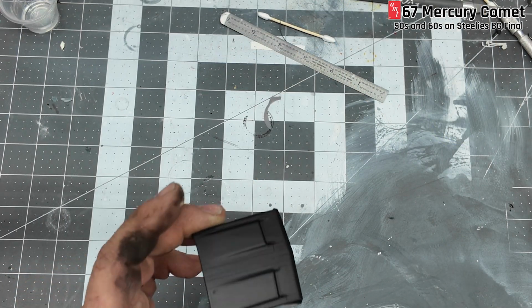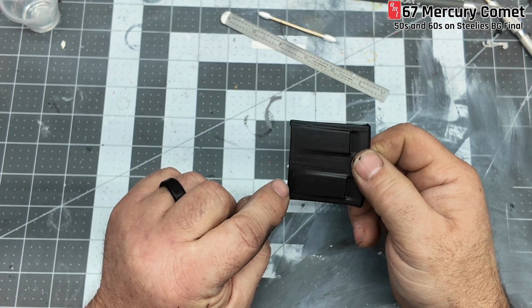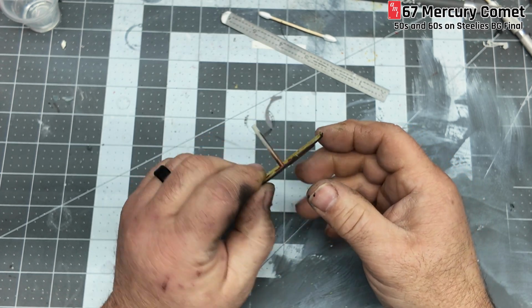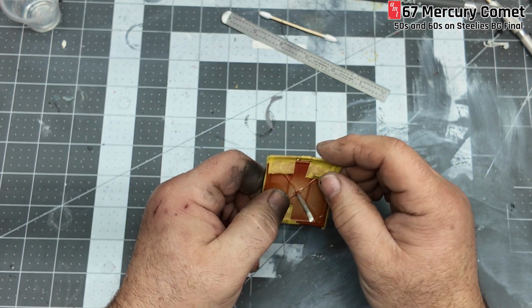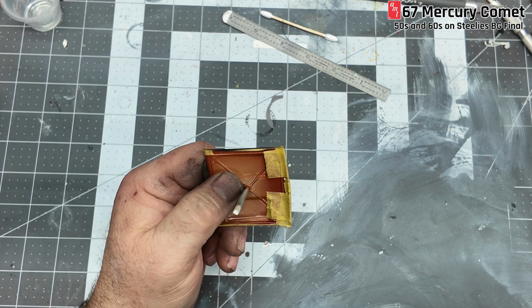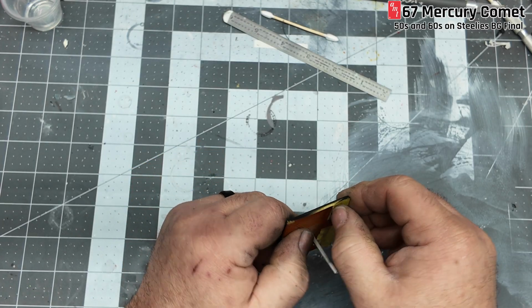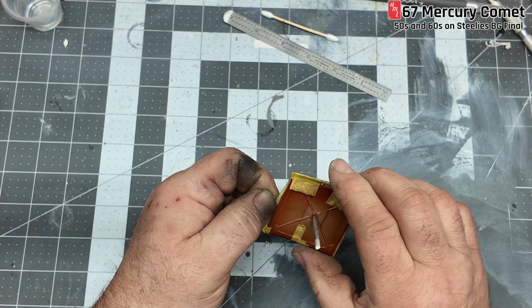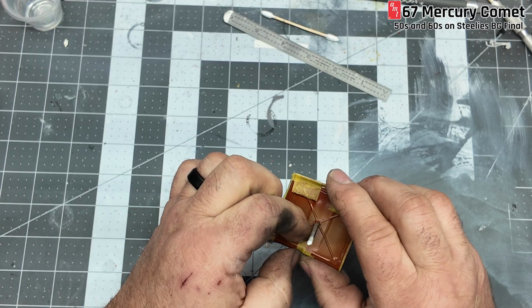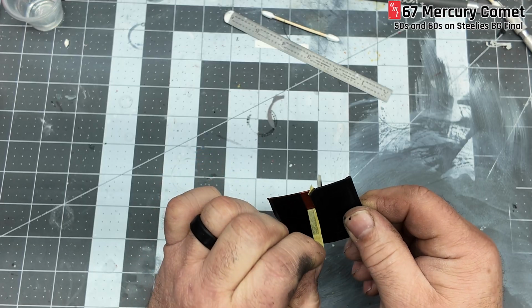All right, guys, so we got this hood painted. Not overly happy with it. I got a big blemish there, and I thought, cool, we're good to go. So I sanded it and repainted it, and I got another one in there. I thought, oh, man. So I don't want to keep going because I'm afraid what I'm going to get right now, because I don't want it to be too thick. So here's hoping it's not overly thick and we didn't get a bleed through.